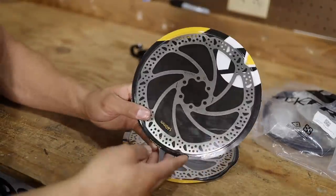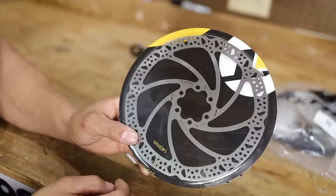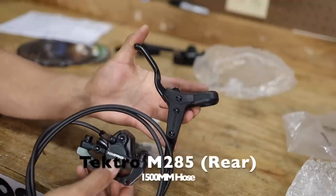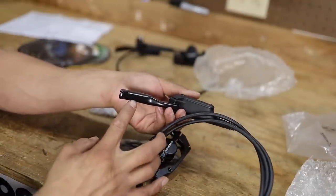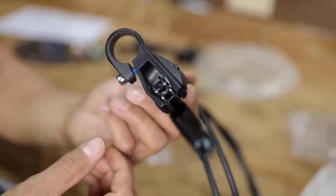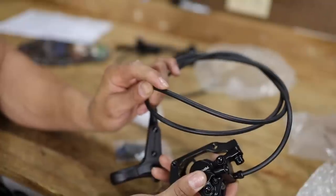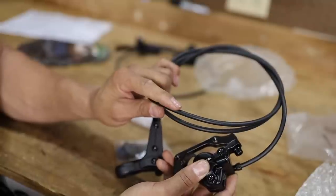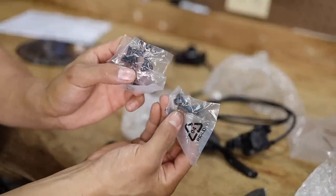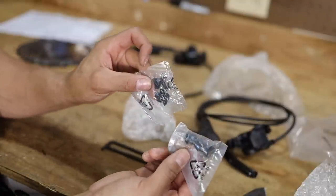Let's take a look at the rear one right now. Here's the rotors - really good-looking rotor. 180 millimeters, both front and rear. I've been having a problem getting these things backwards recently. Good thing they have the arrow indicator on there. I'm a little wary on crashing and breaking off that lever. There's a reach adjustment on both front and rear, just like all the other budget brakes on this channel. I'm used to the BH59 hose - this hose actually has some width and girth to it. It might be a little sketchy running it internal. We're going to have to cut this rear one down - it is 1,500 millimeters. We've got mounting hardware, and a lot of the stock stuff has thread lock that eats up when you unscrew it, so we'll have something brand new to put in its place.